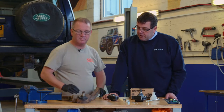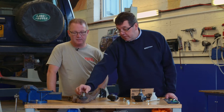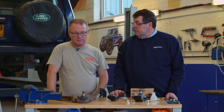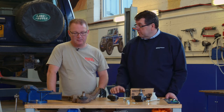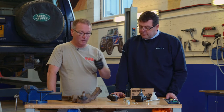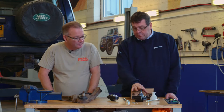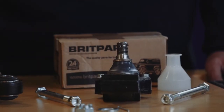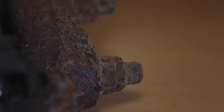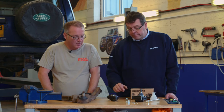What would you hear? Normally, you hear a clunk on the back axle and it sounds like the whole axle is coming loose. But a very small amount of this is magnified through the car, and because it locates into the axle, it sounds absolutely terrible. Well, that looks pretty mullered to me. What pieces replace which here? Here we've got the replacement fulcrum bracket and the ball joint. As we can see, the bolts in here have been in a long time - they'll be rusted all the way through. Easiest thing to do is cut these bolts off and replace them with new bolts.